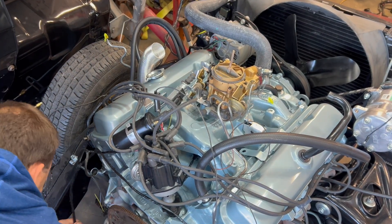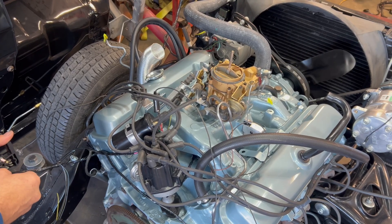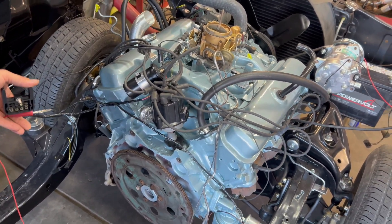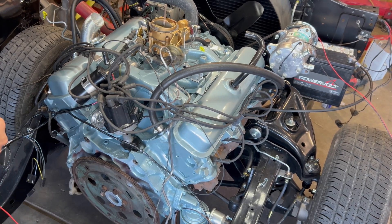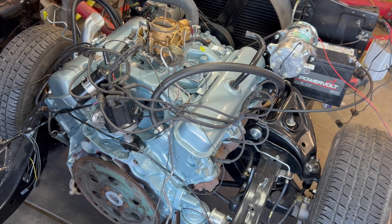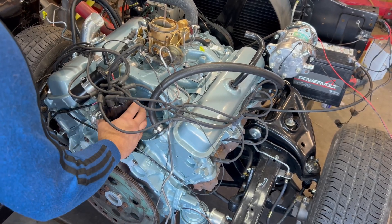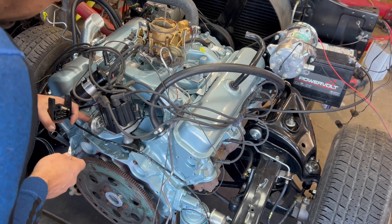Contact. That's a good lesson. Kick this back a little further. Watch the flex plate here when I do that — you'll see it. That's the spin — it almost kicks it backwards. See how that went backwards? Now you're going to be asking yourself why is it doing that. Well, let me tell you the secret: timing's too far advanced. It's actually kicking the engine, or we'll call it bucking the starter. So I need to back the timing off and I bet you our results will be different.